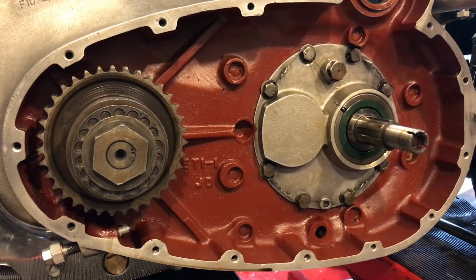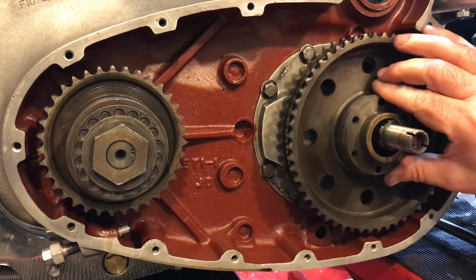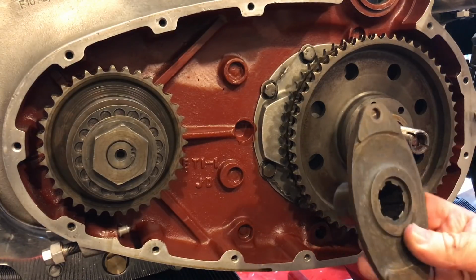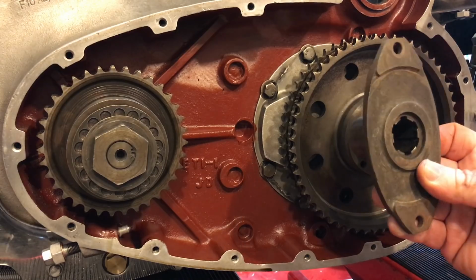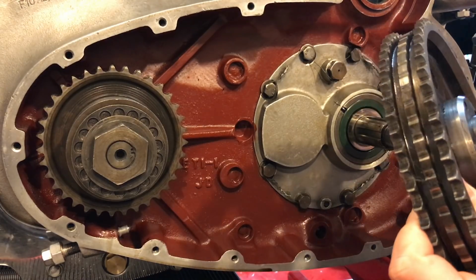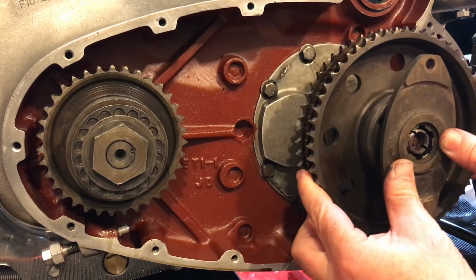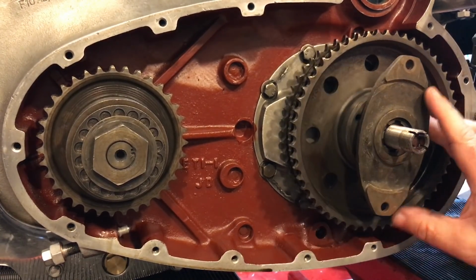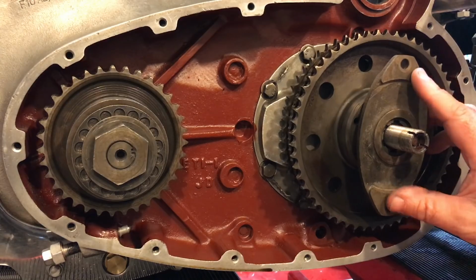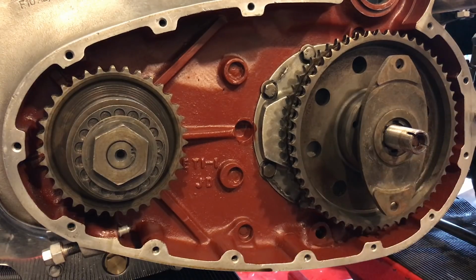If you remember, we had the sprocket with the chain on it earlier that was offset, and therefore the chain was super slack. What we can do then is take this clutch shoe carrier, which I got from my friend John, so thanks a lot, John, as a spare, and insert that into the sprocket, and then place that back on the spline, which centers the sprocket. Now if I put the original chain back on, and the tensioner, I should be able to measure just how slack it was before I go ahead and get the new chain.